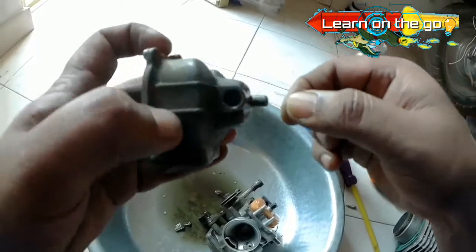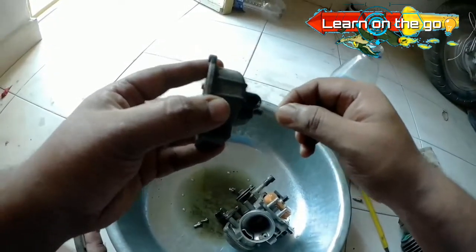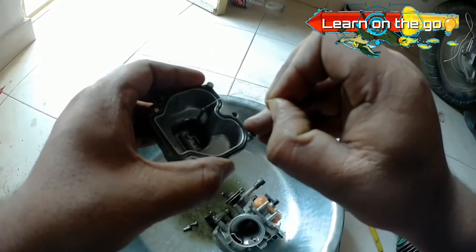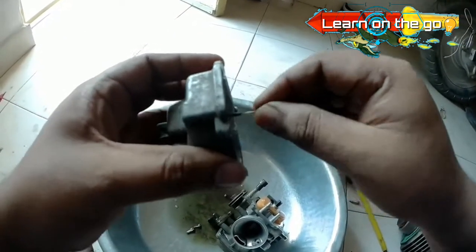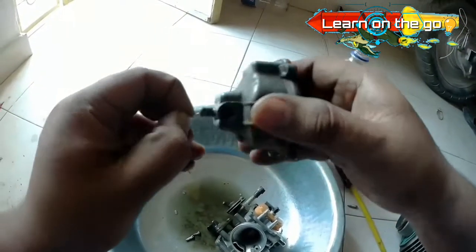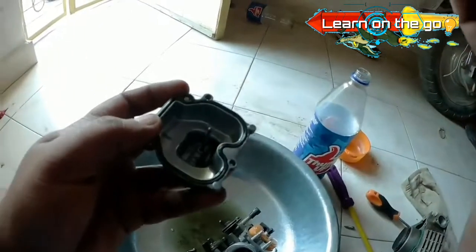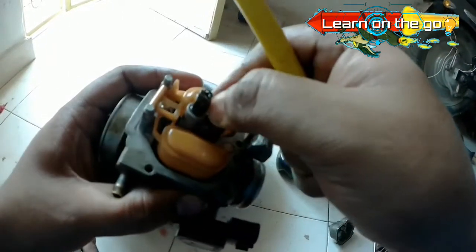Use the same old technique of using the thin wire to declog any debris if there is any accumulation at that particular area. While doing all these operations, make sure that the wire that you are using is not a weak kind, as in case it gets broken while the process is on, it would be very difficult to take it out of those tiny fissures. A stainless steel wire is good for this particular purpose, and if you are not able to find one, you can just take it out from any wire brush with appropriate size of bristles.